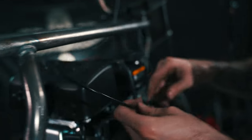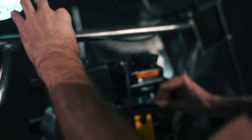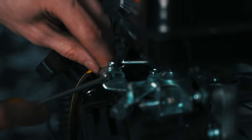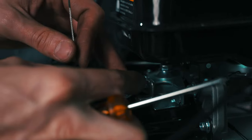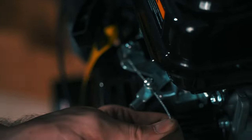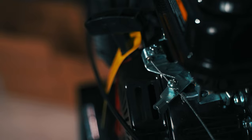Take your throttle cable — make sure it's not touching your muffler. You can run it behind the hoses to keep it away from your pull start, and make sure that it's not on your choke lever, because you'll zip tie this up here. Run your cable under this piece and get the end of it right at the edge so you have full throttle when you need it. Snug it down. There's a little hole in this piece where your cable is going to run through — run your cable straight through it. Keep it snug so you don't have slack, but don't pull too hard because it will twist your throttle. Get a 10mm wrench and snug that screw down. You've got a throttle.